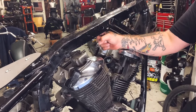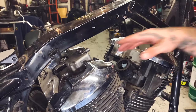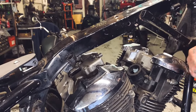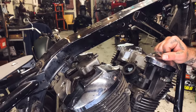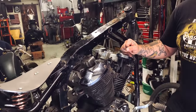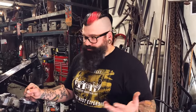It's really gentle, but there will be some kind of mist over a period of time. Honda generally has a tank where this runs to in order to collect that, or it'll go to the back of your intake and collect in the bottom of the filter. Both are nice ways of collecting the byproduct. The EPA would not allow Honda to spew engine refuse on the ground, so they had to figure out somewhere to put it — typically it'll go back through the filter in the intake or into a little collection box.